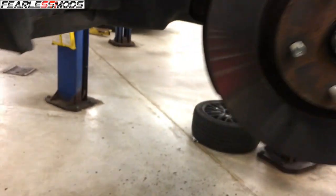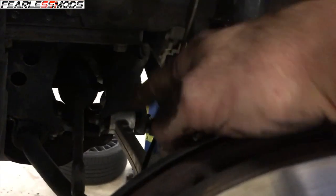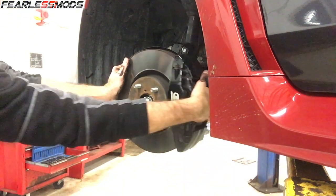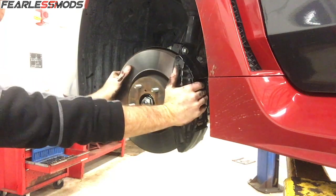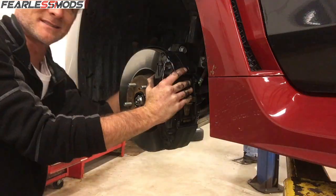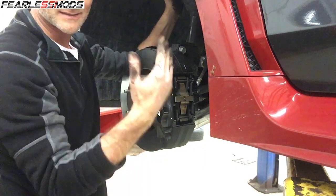Here's what we're dealing with. I pulled the wheels off to see if there's any free play in the struts or any of the components. Everything up front seems to be good. When I go full lock it goes smoothly on either side, both ways, but when I rock it back and forth you can hear it and feel it. I'm guessing maybe that's something to do with the power steering rack - maybe because it doesn't have fluid in there pressurizing it right now, and the plunger is just moving back and forth. I'll raise it up higher and get a better look.